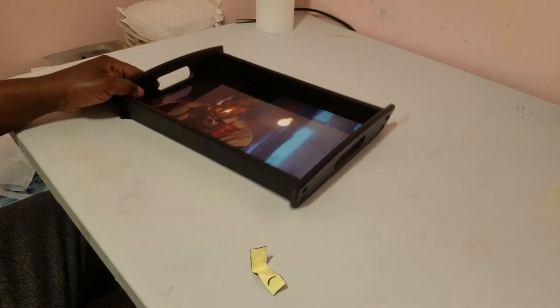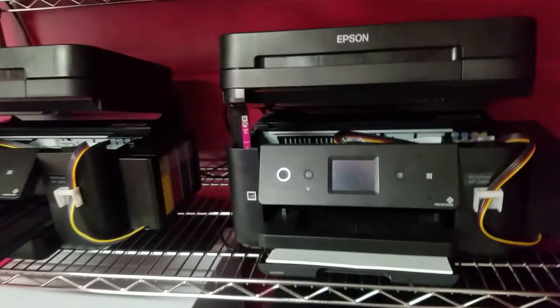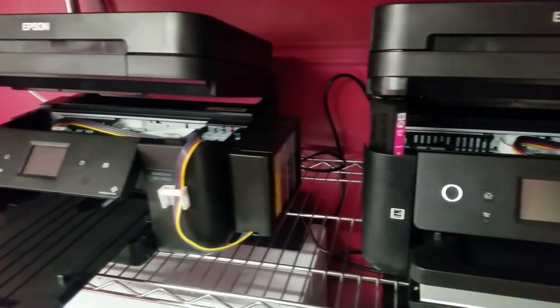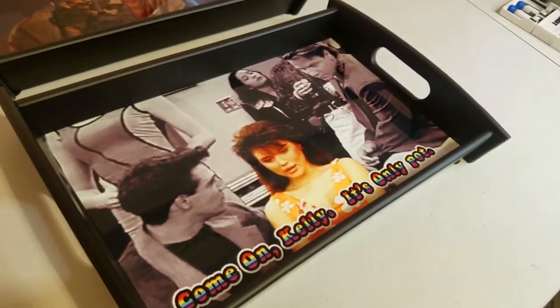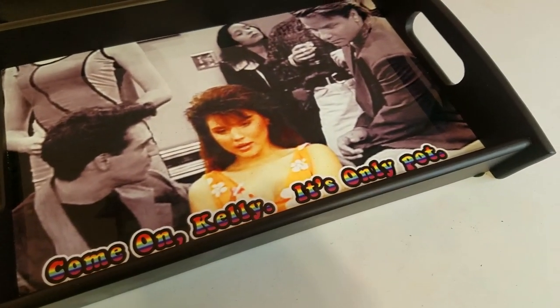And there you go. So that's how I set up and install the CISS for the WF2860. And this is definitely a must if you plan on printing off multiple sheets at a time. Also remember that you must have Chipless Firmware installed to set up the CISS and use a printer in this manner. And I'll put a link in the description of the previous video where we set the printers up.